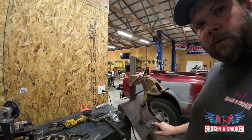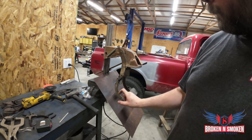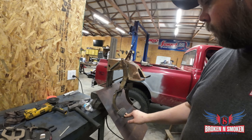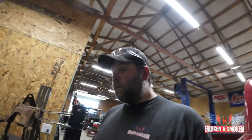Well, I think we're getting somewhere. Got this clutch one done now. As you can see, we got some movement, but not as much as we had. Me changing this two inches shortened that throw from an inch and a half to seven-eighths. So I know we're going to have to come up here and do some modifications up here next — all that rigmarole.